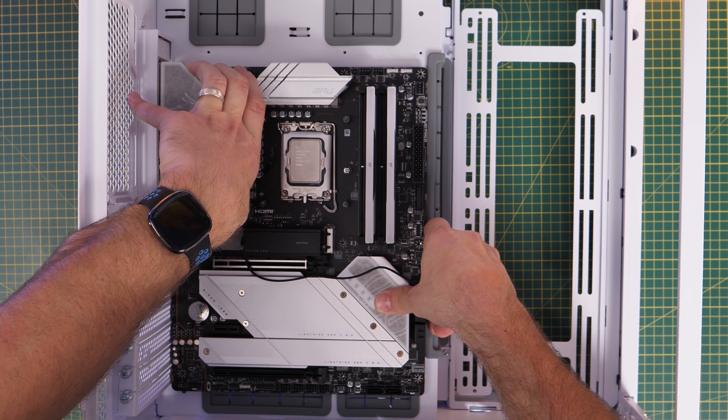In mFlash, you can check your current build number and then select the BIOS version you've downloaded to a USB stick from the list of files. It will ask whether you want to proceed — tell it yes and it will go through the BIOS update process. Obviously this will only work if you can already boot your machine, either with a compatible CPU or another CPU, but that's two different ways to update your BIOS.